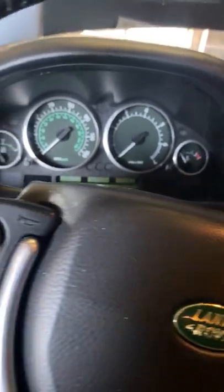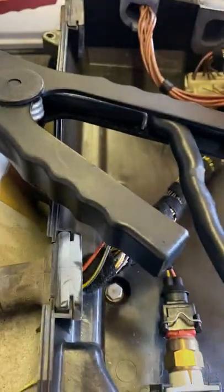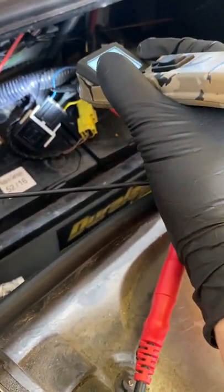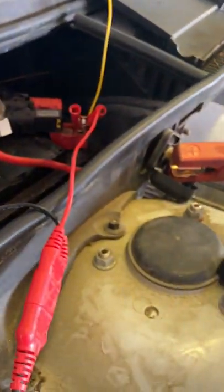And it turns on. So to verify — the blue wire goes to the TCM, and on the TCM connector it's actually exposed. You can test resistance from that wire to the relay wire, and if you have low resistance, you know the circuit wiring is good. We also know the relay is good because the vehicle just started, and we know the yellow wire is good because the PCM grounded the relay and the vehicle turned on.